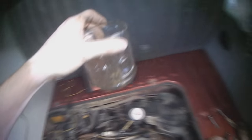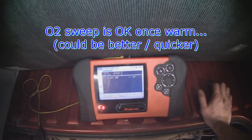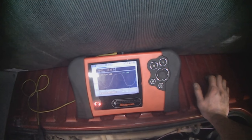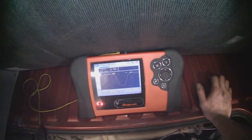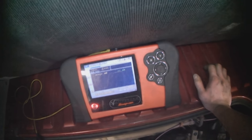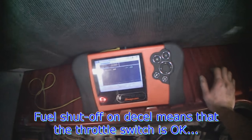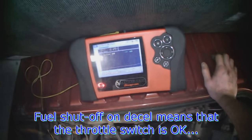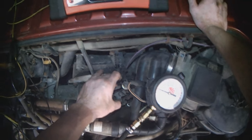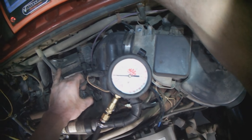Check fuel sample — fuel sample is not too bad. O2 sensor cycles pretty good, fairly nice sweep. That's the closed throttle switch cutting fuel, so the closed throttle switch is usually one of the first complaints or issues to look at. Fuel pressure is good — it rises on snap.